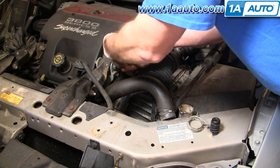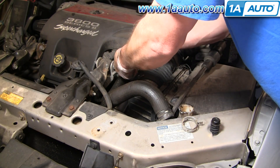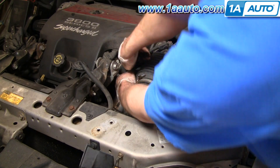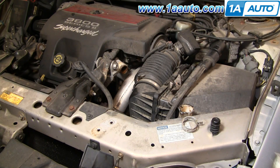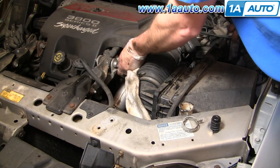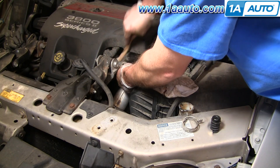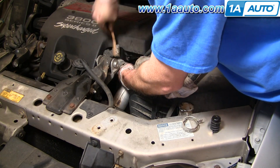Same thing over here. Get on the clamp. You can get it twisted — that's always good. Let a little bit of fluid come out. Get both clamps off. Use a little rag to wipe out this hose fitting. Stick it in there a little bit, take a wire brush, and knock off some of that corrosion.